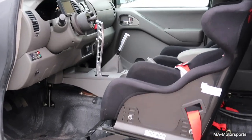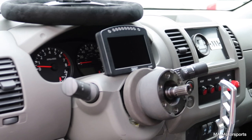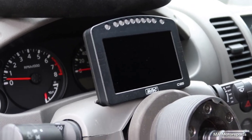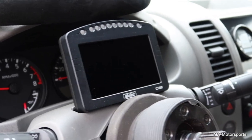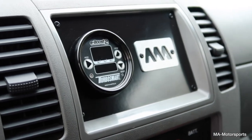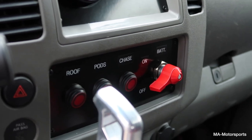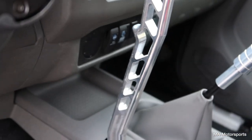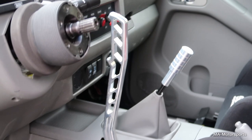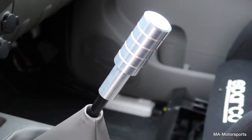Inside, we removed some of the creature comforts but it's got what you need to have fun. There's a MoTeC C195 dash logger so you know the engine vitals — factory gauges still work behind it. The boost controller is a standalone Turbosmart E-Boost 2, something we use in a lot of our builds and they work really well. A switch panel in place of the HVAC controls just runs the lights and a battery cutoff switch. Hydraulic handbrake for having fun — that's Chris Forsberg's signature CF64 billet handbrake handle, just the right height. We also built a handmade shift knob here as a little accent part.